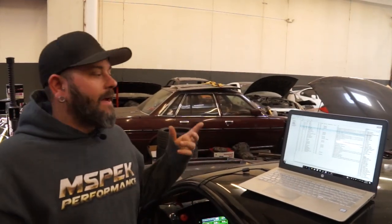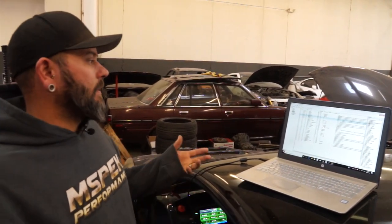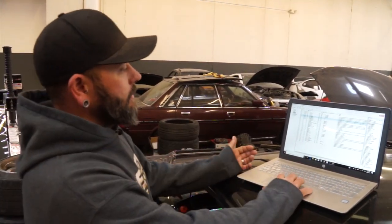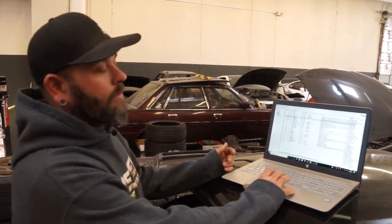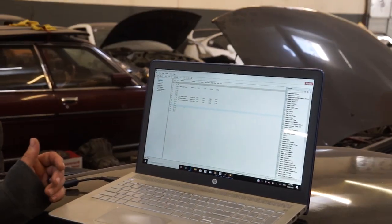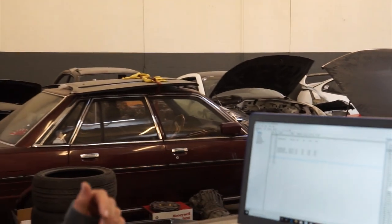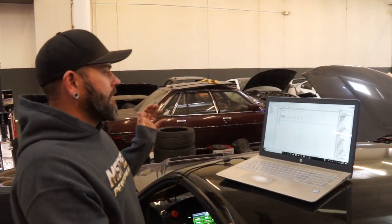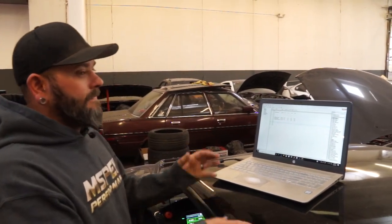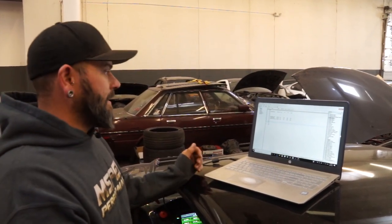So we've talked about CAN inputs, going on the CAN network, using engine parameters, as well as the outputs and stuff. You still can wire these in a more traditional way. The traditional way being using an analog input, so an actual switch. We chose to use data to control everything. Number one, it's there, so why not? Number two, challenge ourselves, right? Learn something new. And number three, if that network goes down, then everything goes down. So simplification, name of the game.